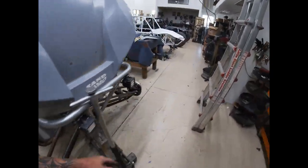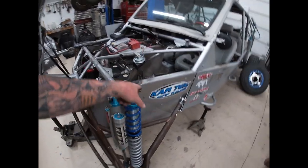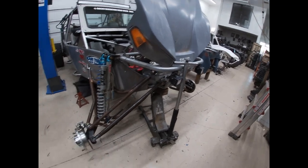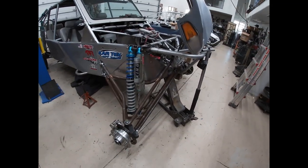Now I'm going to come over to the other side, take the upper bolt out, put the washers in, get it bolted down tight, and then go ahead and put the wheels on so we can get the tie rods adjusted - at least get them close until Joe gets here, since he's the king at that. I'll get the brake lines all tie-wrapped up and we'll get this thing back on wheels today.